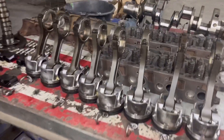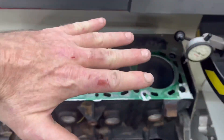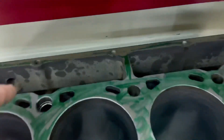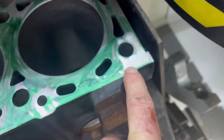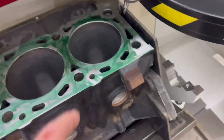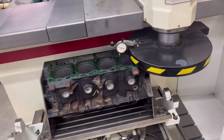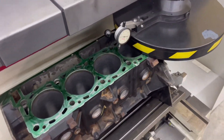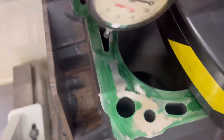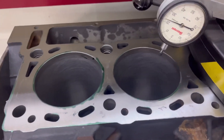We're going to go ahead and redo this existing engine. The problem is over here where the head gasket blew - right there, and that's pretty freaking deep. I've got the levels a little off right now - I'm a little high on this side and a little high on the front. You can see it cut all the way to here, and then here it just cut like an L. I need to raise it up a little this way and that way. This deck surface is fighting me - I've adjusted it a whole bunch of times, what a pain in the butt.